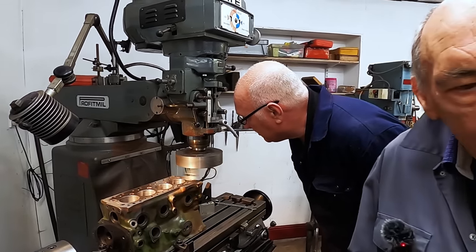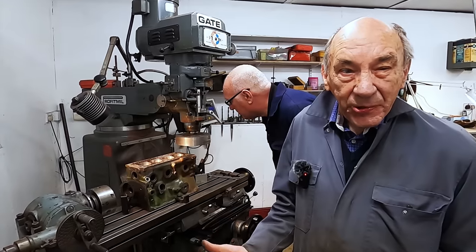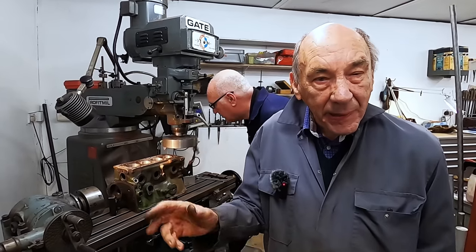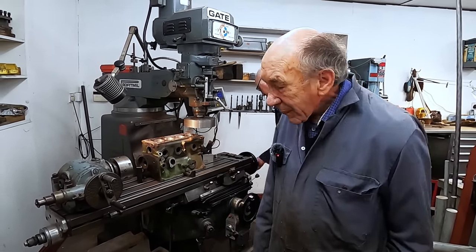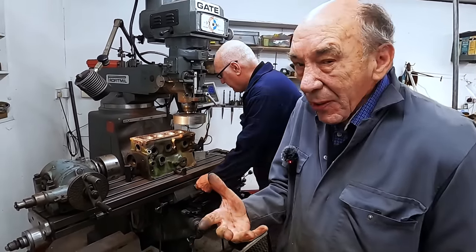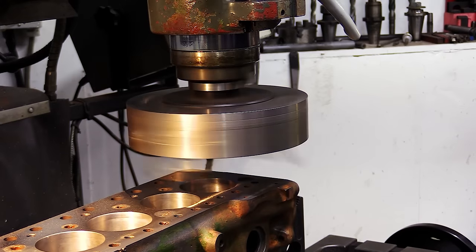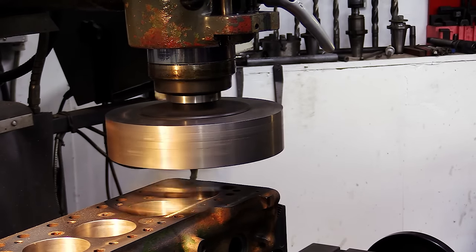Now you can see what I mean about taking the plate off that's got the number on. The minute you do this, you've got to take it off. Getting them rivets out's a nightmare. The plate's made of aluminium, so the minute you start banging anything, the plate gets destroyed. So that little tip of unscrewing them really works. When this is done, we will put the plate back, because it's a matching number car, so we don't want to lose the plate. Giving that a nice finish for the head gasket. Yeah, I reckon that's really good from a head gasket point of view.